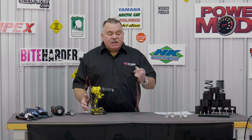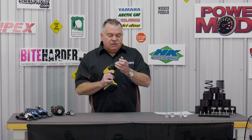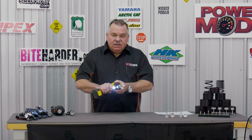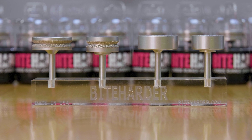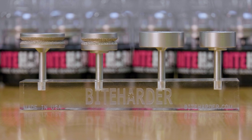Talk about convenience — our standard series carbide runner sharpening tool, which today is still our best seller, is designed to run in a cordless drill. Simply put it in your cordless drill, tighten it down, set it on the highest speed and you are ready to start sharpening. We recommend maintaining your carbide runners every two to three hundred miles, or depending on the conditions you're riding in.